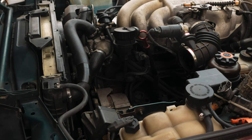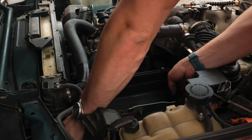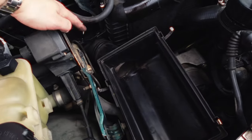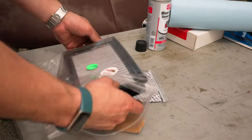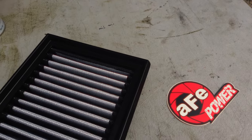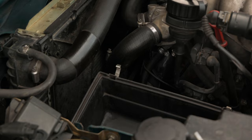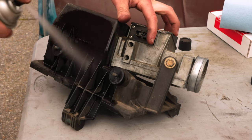I'm not trying to make this perfect — right now is all about making improvements, not perfection. I tossed in the lower part of this intake and intentionally attached it, unlike what it was before. Here's a great look at why the stock E30 intake is actually really good: the air that comes through here comes directly from the front part of the grill, so it's as cold as it can possibly get. Before I took this apart, that tube wasn't even installed, so it should work a lot better. Since the filter was properly crusty, it was also a good time to upgrade it. This is a high flow panel air filter — I don't expect this to double or triple the horsepower, it just gets us slightly more flow and, in conjunction with a properly fitted intake, I think we're going to get some better throttle response. I'm also using mass airflow sensor cleaner on the inside of this box to get all the dirt out, since it's already rated for going into the intake track. This episode is all about functional improvements.